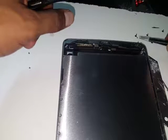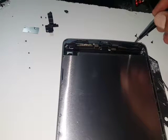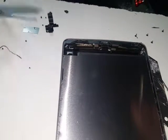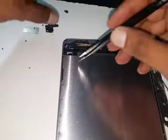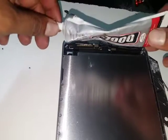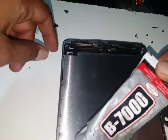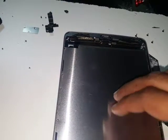First clean everything — there are cleaning brushes with fiber or rubber tips. Don't leave any pieces inside. One important thing: if your screen is in this condition, please wear safety glasses so no small piece damages your eye. Once you've put the plate back with all screws, put the LCD on top, then the digitizer. To seal it, people use double-sided tape, but in higher-temperature countries it can come off. I use tape all around the corners to seal it off — no dust gets in and it doesn't come out easily.